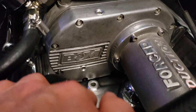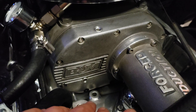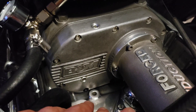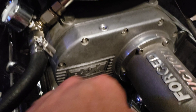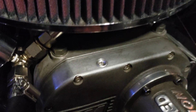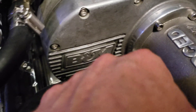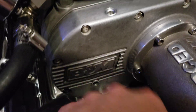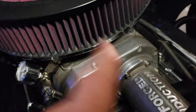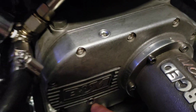You're not really changing the oil here — you just top it off. Unless the car sits a whole lot, then you might want to consider flushing it out. You can do that a few ways: use a suction pump and suction some oil out then top it off, or flood it and capture the oil to clean it that way, or just add oil, run it, add oil, run it — keep doing that and you can flush it out pretty well.